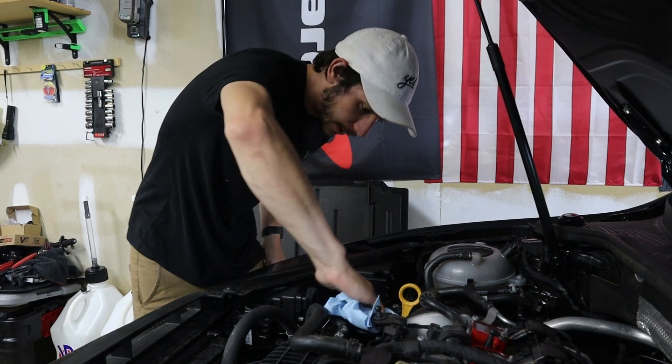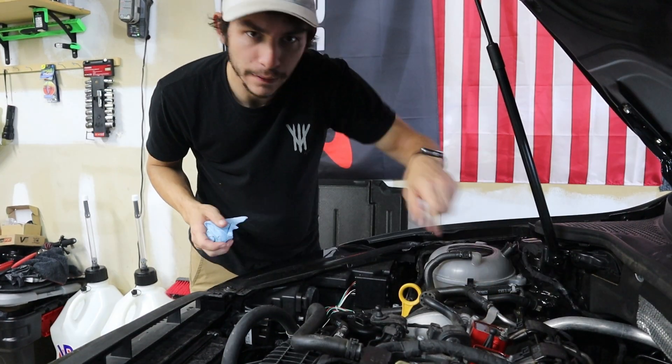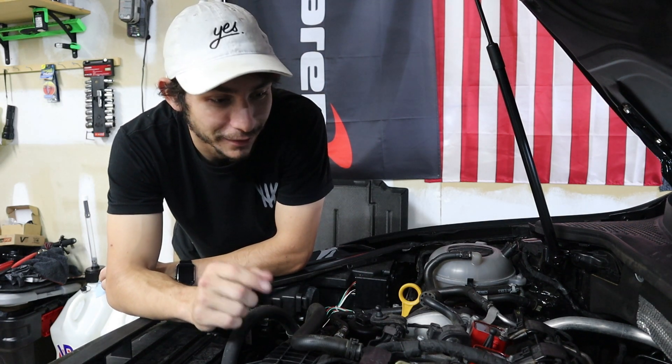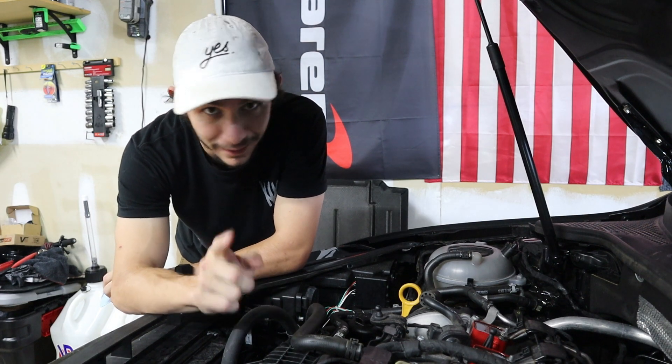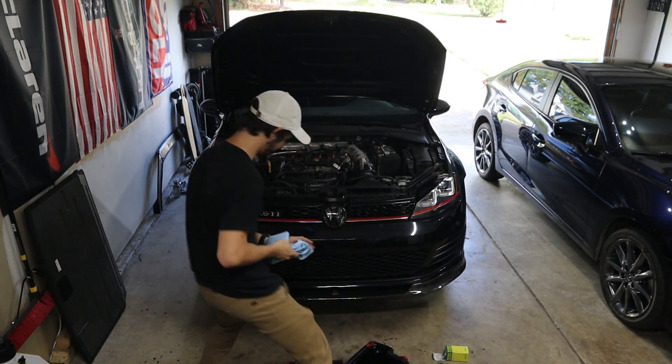We're wiping down any oil inside the engine bay — mainly around the filter — and we also dripped a little bit on the timing cover but nothing bad. The oil drain plug clicks into place when it's tight — keep in mind you don't want to over-tighten it because it will break the little clip holding it and it will no longer be a good drain plug. Oil change is basically done. We'll lower the car down, crank it up, let the oil cycle, do another check of our oil levels, and then reset our service light. Checked the drain plug under the car — absolutely no leaks.